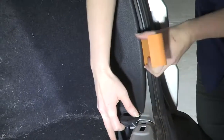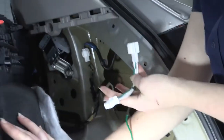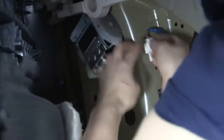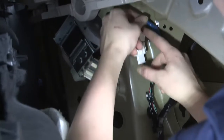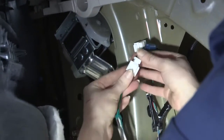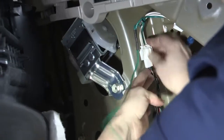We're now ready to remove our passenger side interior panel. It's going to be the same as we did on the driver's side — we're going to use our interior trim removal tool. Tuck it between this door panel and the weather stripping. You can separate these two panels and just fold this out of the way. Here's our green wire that's attached to our circuit. We've got our connectors here and we're going to plug them into this connector — it disconnects just like the one on the driver's side. So we'll just push in that tab, lift that connector up, and now it's ready to be plugged into our harness here. Everything's clicked into place.